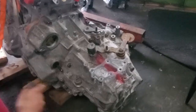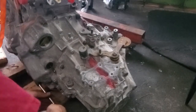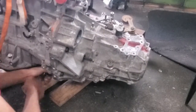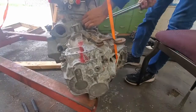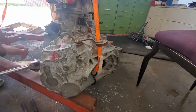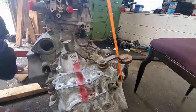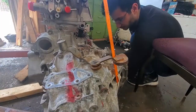I put in a few bolts to hold the transmission in place while I made sure. Just two bolts at the top with a few turns should be fine while you install the rest. The important thing is that the splines have lined up before subjecting them to several hundreds of pounds of force from tightening all of the bolts. After installing and turning all of the bolts to just finger tight in all the proper locations, go around in a circle and tighten each one only slightly. You don't want to slant the transmission forcefully by torquing it down only on one side — just like the flywheel bolts, make sure its face is always parallel to the engine.